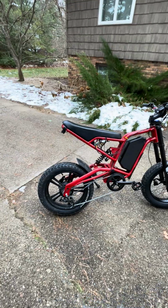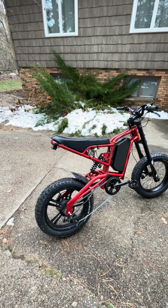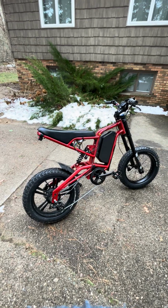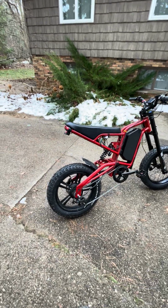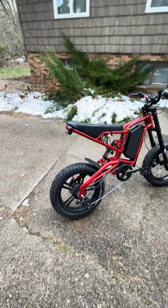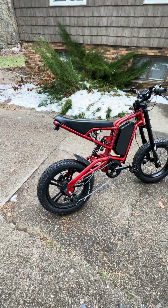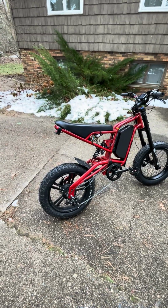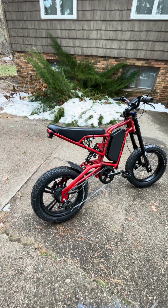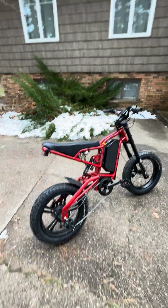But it still works, and I was just cruising around on it. I dialed it up to 45 amps, but the battery was down to about 52 volts. So whatever 45 times 52 is, it only got up to like 1800 watts, and it seems perfectly fine with that. Even after I dialed it up from 37 amps to 45, I didn't really notice much difference in the responsiveness out of the gate, but that might be just because the battery is getting kind of low.